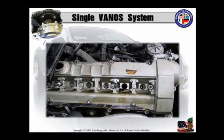If some idiot previously installed the gasket with Gorilla Glue instead of RTV silicone, have fun — but be patient. Plasticized rubber gaskets tend to blow apart in a million pieces, and usually those pieces drop inside the head and make a mess of the entire oil system. So be patient. The rear cover perimeter half-moons, due to usually excessive gluing, are usually very uncooperative. So again, take your time. You're going to replace the gasket anyway.